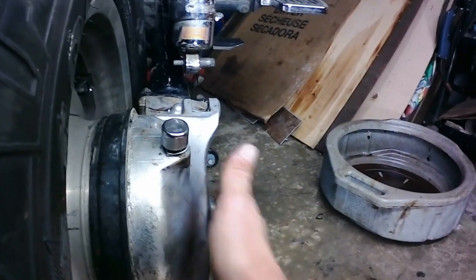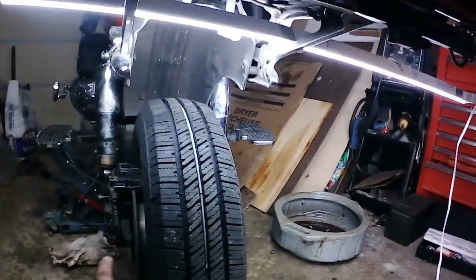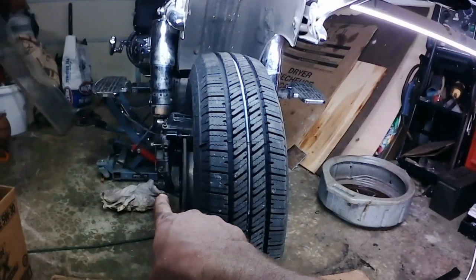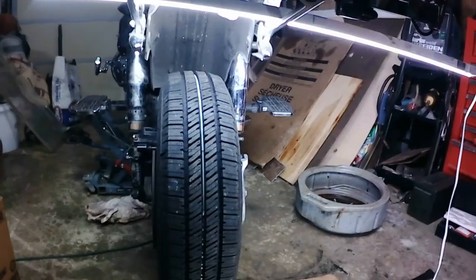We've got the axle nut is in, it is torqued. I have replaced all the O-rings, the thrust washer, O-rings in that side, wheel bearing seals. I've got one bolt to tighten up on the brake caliper. Torque on the axle nut is 81 foot-pounds, and the axle nut does go in from the drive side.